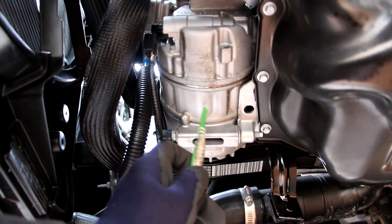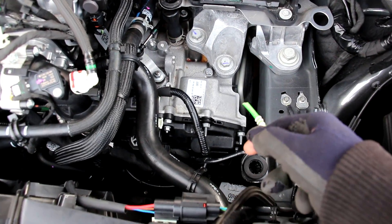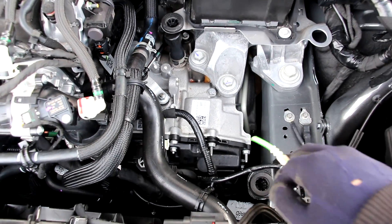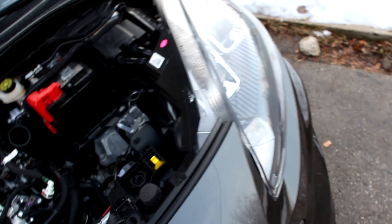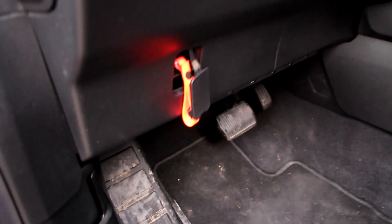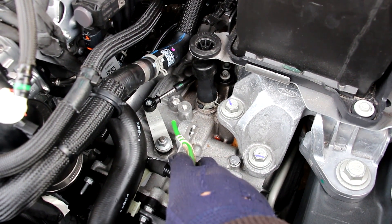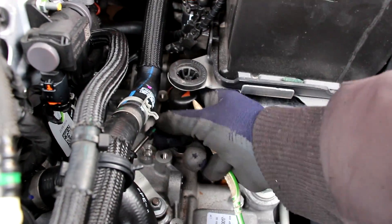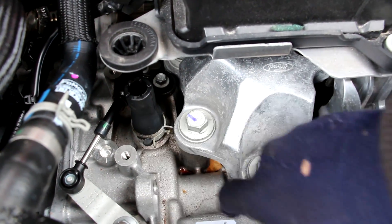The AC compressor is accessed from the bottom and is pretty easy to remove once you get all these hoses out of the way. With the airbox removed you can see clear access to the transmission, which is Ford's 8F 8-speed automatic transmission — actually based off of a 9-speed GM transmission. Just at the front of the transmission underneath this plastic cover is the valve body, with its electrical connectors inside. Just behind the fog light is the transmission computer, which is a bit of an oversight because one little tap on your front bumper and that expensive transmission computer is toast. Because this transmission is electronically shifted, it's got this little emergency pull tab here to pull it out of park in case it dies and you've got to tow it. That emergency release will disengage the parking pawl through a lever at the top of the transmission. Just underneath the battery on top of the transmission we have this vent, and if you pull off the cover it becomes the fill port for the transmission. This is a brand new vehicle and you can already see that it's been leaking, which isn't really good.